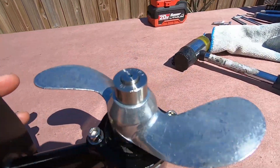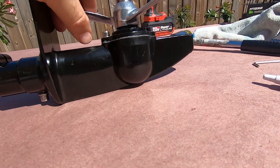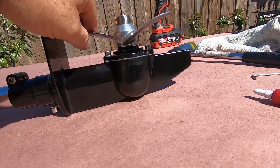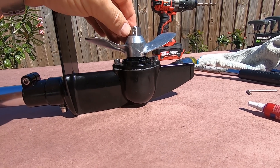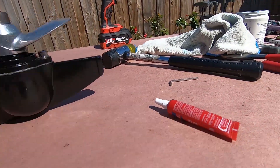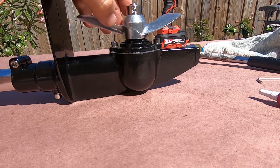Now it's on. There's a little gap on the bottom — remember these hubs were ground from scratch, so a little gap is expected. Grease the shaft to make it easier to install. Once the collar is on, make sure you put a little thread lock where it tightens down — that's especially important if you're adding it later on.